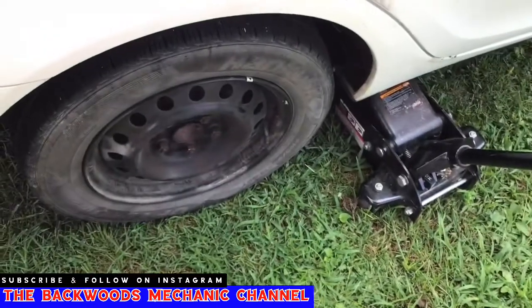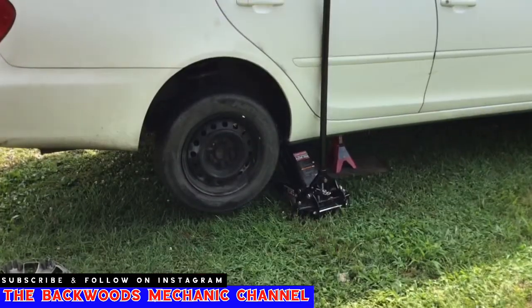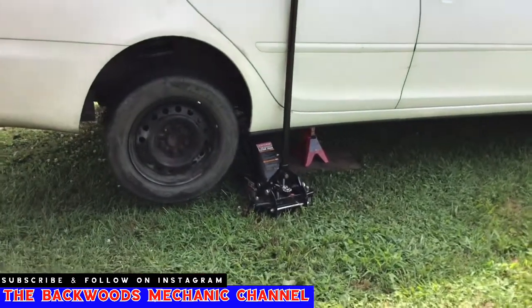It's best to jack up the car part of the way, leaving the tire halfway on the ground. That way you can break them lug nuts loose. Then the next thing you need to do is jack up your vehicle and safely secure it with a jack stand.